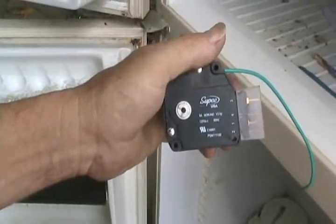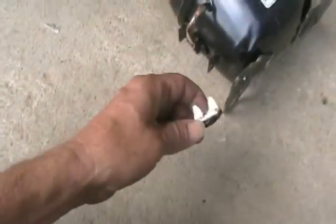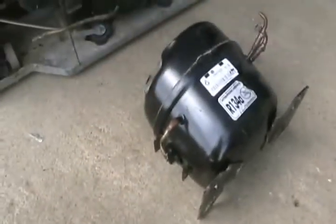It's one of the most common things that goes wrong in refrigerators. If your fan's running and your compressor's not running, then it has nothing to do with the stuff I just showed you. That's a problem with the compressor. That can be a burned out starting relay, a burned out overload, or it can be a bad compressor.